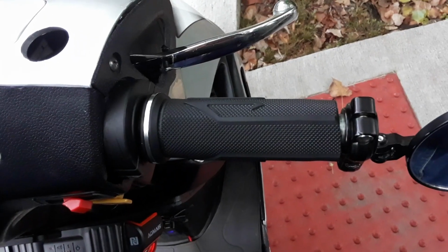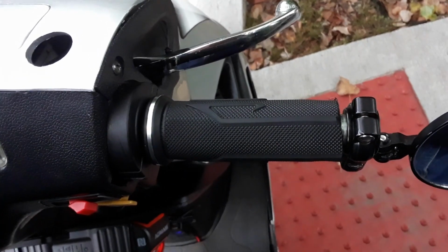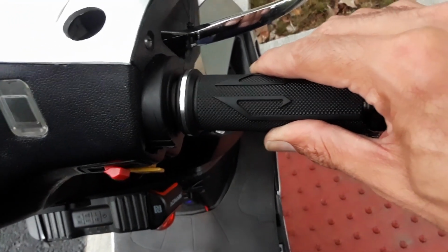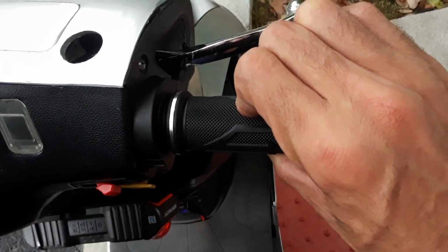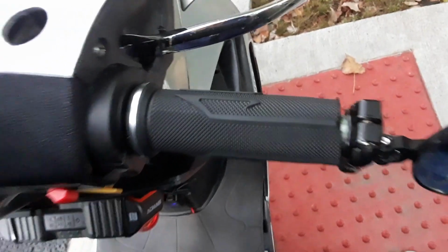With the pipe on, I won't be able to show you exactly how the slide moves. Again, you can refer to Roma Custom's video for that. But I'll tell you, once I pull this throttle, that slide is rising. And the more I pull it, the more open the venturi is. And she snaps back pretty well too. So it's an immediate response.